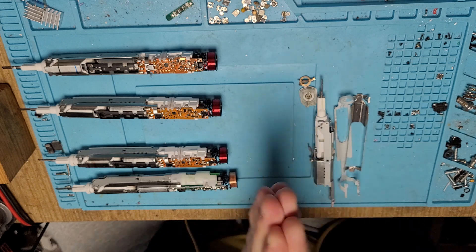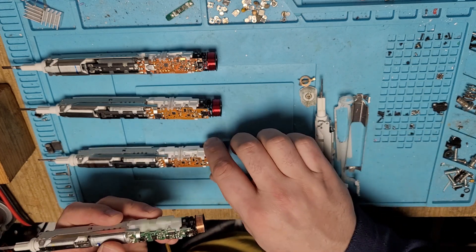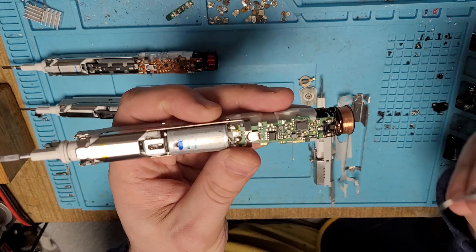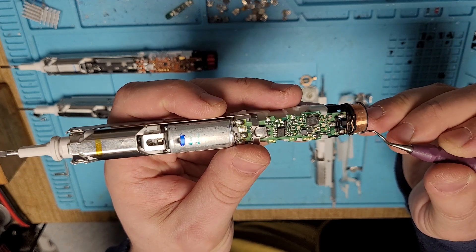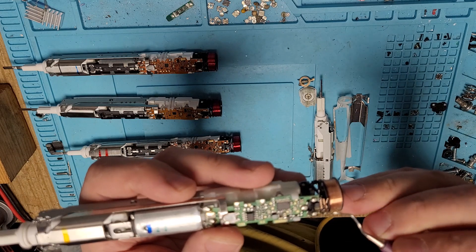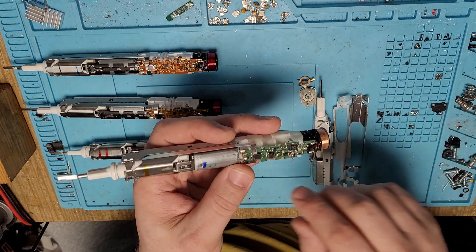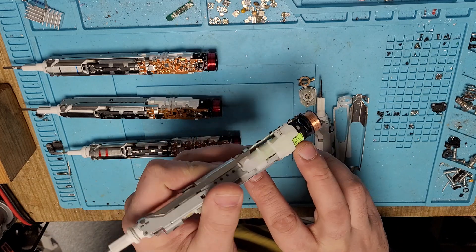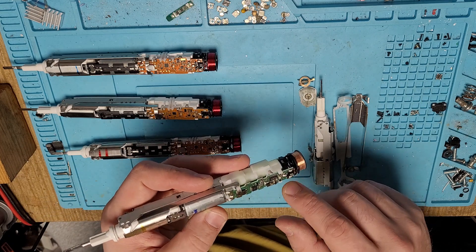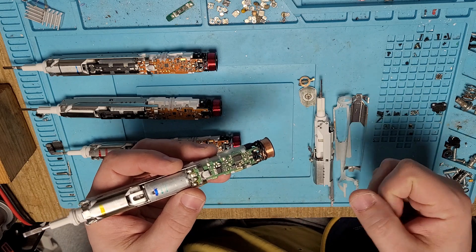The main defects I found - the easiest ones are broken solder points. On this one we have a charging coil wire that broke off. I'm not sure why - maybe vibrations or it was dropped a lot. Interestingly, when I first checked it I thought it was just a strongly discharged battery. But I believe Braun has a trickle charging system, so if you cannot charge it, it's usually a problem somewhere in the schematics.